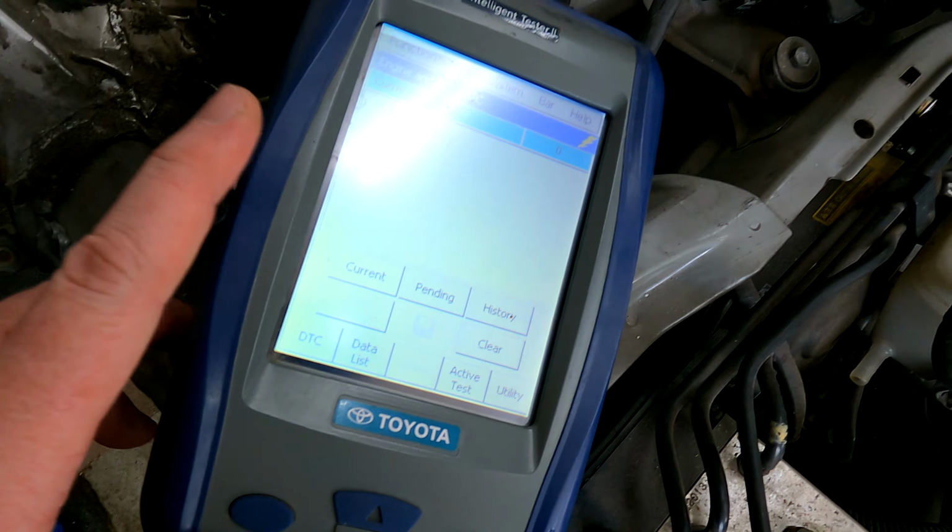In terms of the alternator, obviously it's going to be over here. You're going to run along the subframe, up this side into your fuse box. That's for your alternator to charge. And I think that's about it, really. I mean, that's all you've really got to do. Everything else is just straight plug in. We've already set the rev counter using our OBD2 machine, so that's going to be accurate. And obviously, I showed you earlier when we were busy on there, you would have actually seen the rev counter working there as well. So that's absolutely fine, and we've got no dramas there.